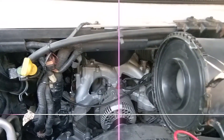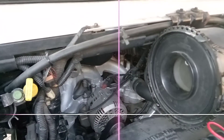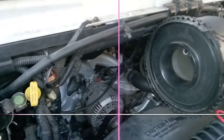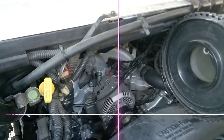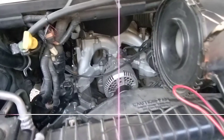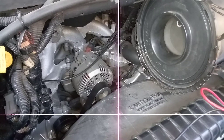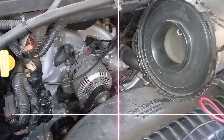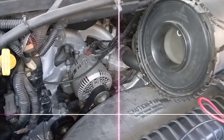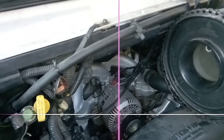We're going to go get an alternator, put this thing back together, put the instrument cluster back in, and hopefully we don't have any more problems. So far, no check engine lights. We did blow a fuse to the transmission shift interlock or speed control module — that might have been a bullet we dodged. We replaced the fuse and all seems to be working without a check engine light. It also happens to run the daytime running lamp module if you have it.